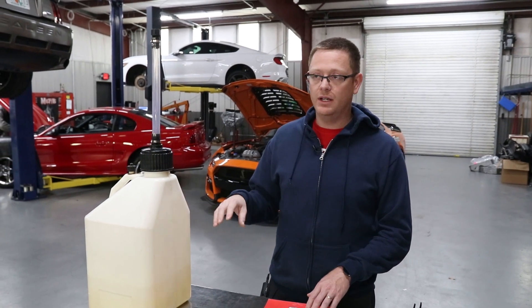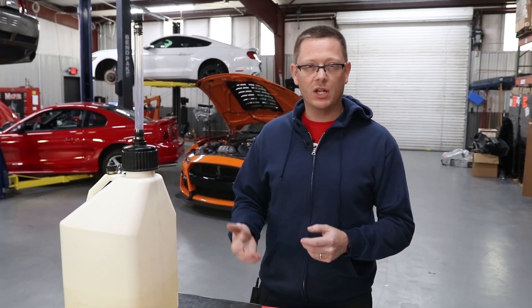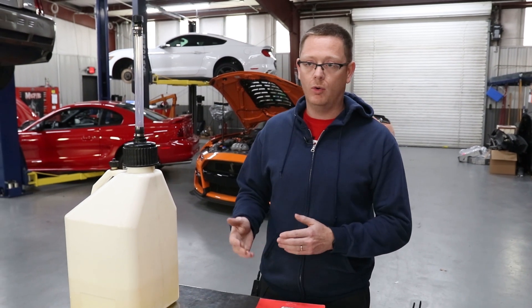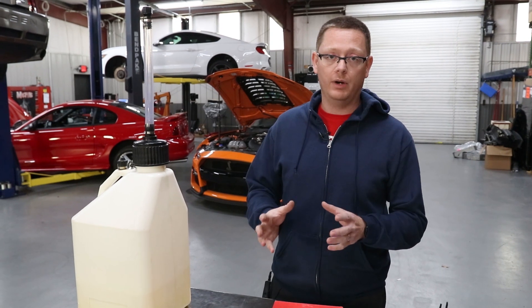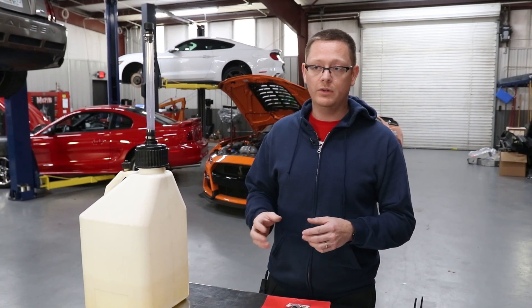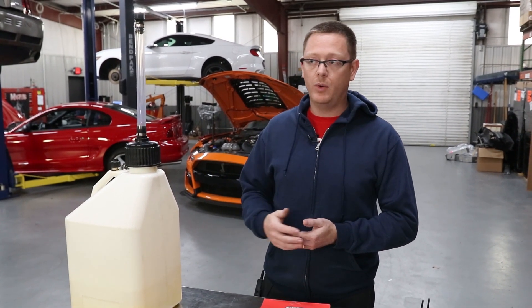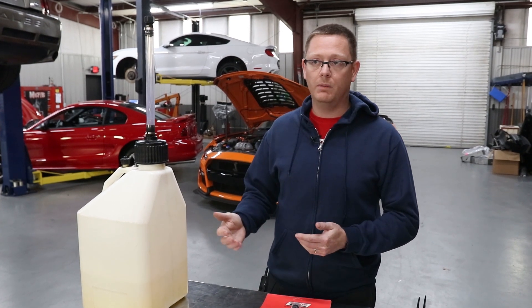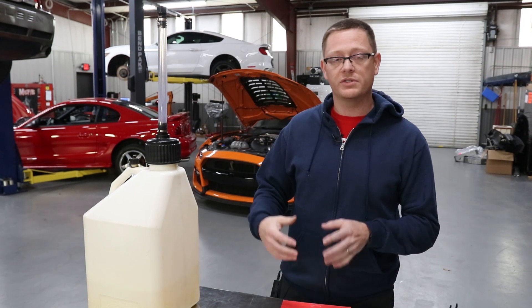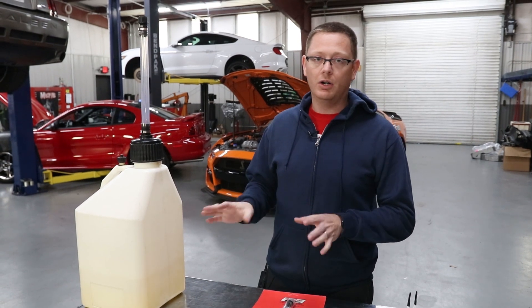One last thing to cover is oil changes — this is a myth but there's some truth behind it. Running E85, especially in colder climates, you do want to change the oil more often, but it is not the end of the world. You don't need to be doing 1,000 mile oil changes. Generally if you have an E85 vehicle and you actually drive it and get the oil temperature up to operating temp, it will boil and burn all the water out of the oil and it won't milkshake the oil. If you live two minutes from work or in a real cold climate it might be an issue — just keep an eye on it. You can also send the oil off for analysis. Generally we tell people to stick to 3,000 to 5,000 mile oil change intervals on E85. I probably wouldn't do the extended drain stuff, but you don't have to get crazy with it.